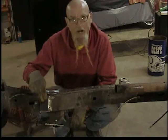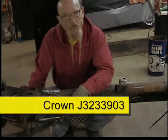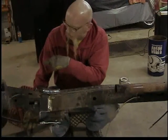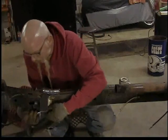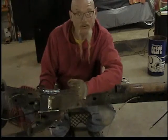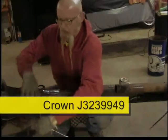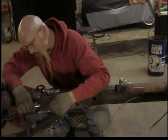I moved this bracket back about an inch or so from where it was originally because the driver's side cable was kind of too short — not sure if it's the lift on the Jeep or the different entry point on the cable at the caliper instead of a drum brake. It should fit now. Just push the cables in until they snap — they've got little fingers that pull out and hold them in place. Then I got the passenger side snapped in too.